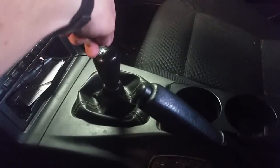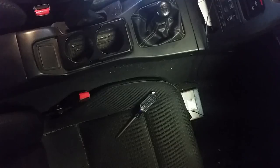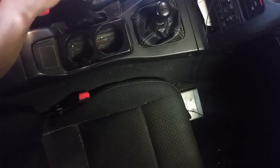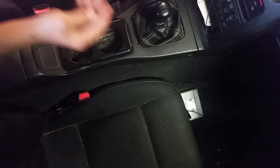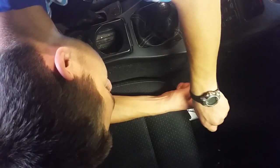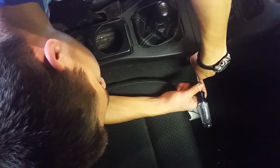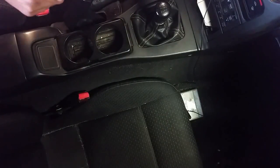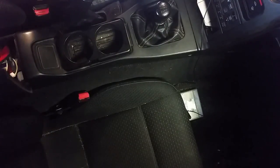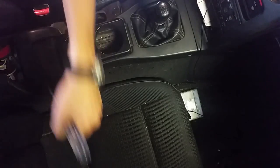Make sure you're safe under there. The first thing I'm going to do is go inside and start taking out the console area. We're going to unscrew our shifter and take all this stuff out so we can lower our transmission. I'll move the screws on each side — there are going to be two inside here.